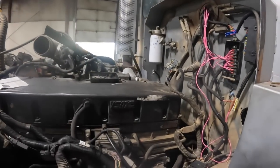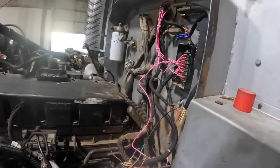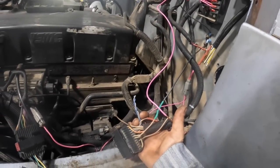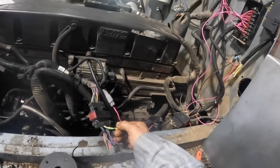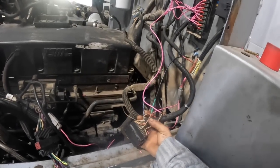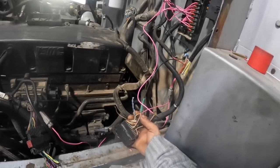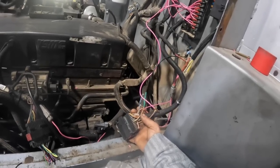Here's an overview of what we've got here. This is basically the transmission harness side. You'll see this gray and blue twisted pair - that's 1708 protocol, that's an older, slower protocol. The yellow and the green are 1939 protocol. Everything on the 1708 protocol has no CAN terminator resistors - everything is built into an RS-485 transceiver inside the control module. There's no CAN terminator resistors.